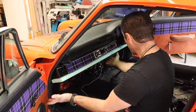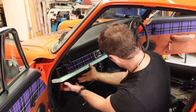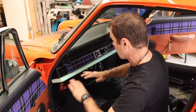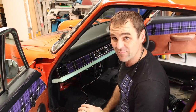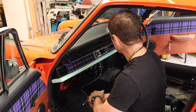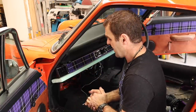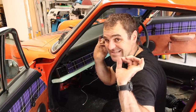A couple of hours later and I'm back to where I started last week — I've got this under-dash panel. It's more reinforced now with that extra metal bracing all the way along, and it fits nicely as one piece. This time, instead of wrecking it with the fiberglass, I'm going to use the fiber filler, which doesn't seem to eat into it. I'll put a nice thin coat of that over the whole thing to give it a little bit more strength on the outside, and hopefully next time I trim it, it should be crisp, neat, and tidy.